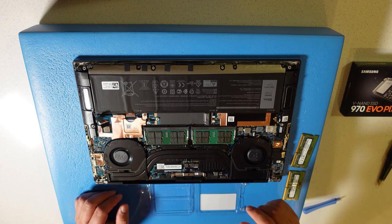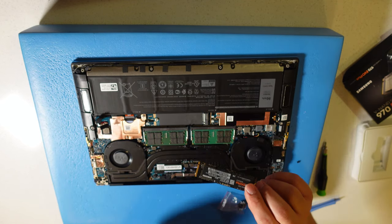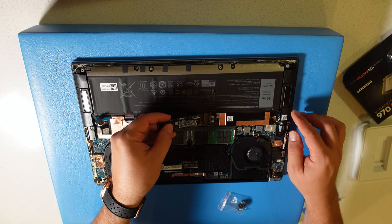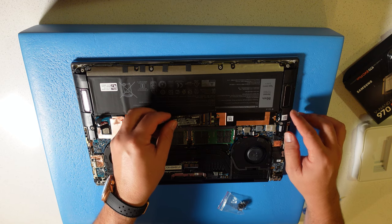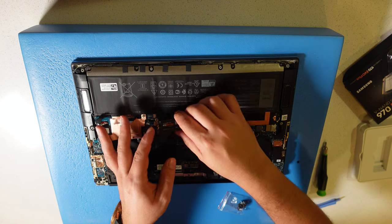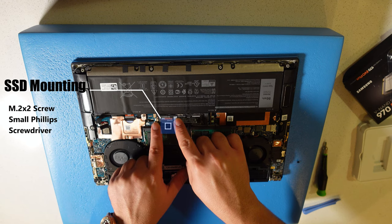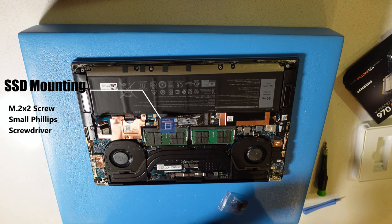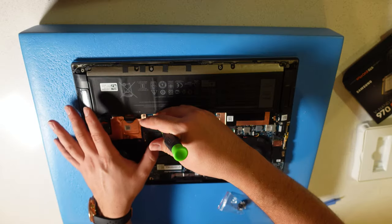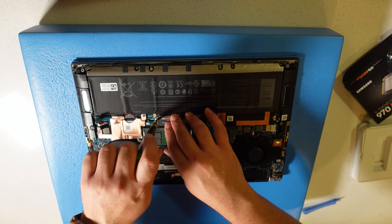Since I'm cooking up the ultimate upgrade, we're also going after the SSD. Take the two terabyte SSD and install it the same way — it goes in at a 45-degree angle and there's a key so it only goes in correctly. Push it in, make sure it clicks, then push it down. You'll need an M.2 screw to hold it down, which the laptop doesn't come with, so source that separately to ensure the SSD is held down correctly.